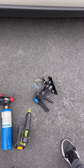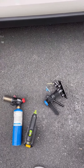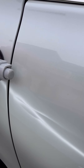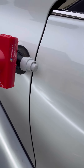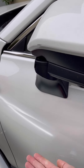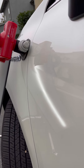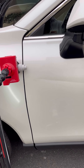I ended up using the crease killer feet and that crease killer tab with the Brazilian silicone-based glue. My first pull was right in here and if you can see that, it really reduced it down to just a minimal crease. The tough part about these creases is trying not to get railroad tracks or stitches, as it's called, because you're working this dent from a horizontal, but when you look at the dent vertically you'll see your push marks. I have to do a little bit of knocking down on that area that I lifted, but if you can keep a crease clean — you see what that one pull did — it really reduced that crease.